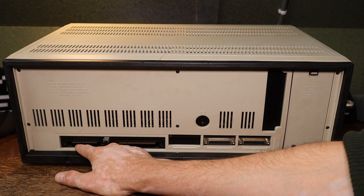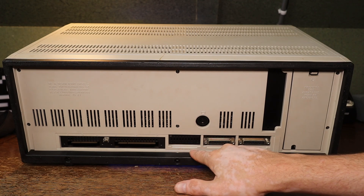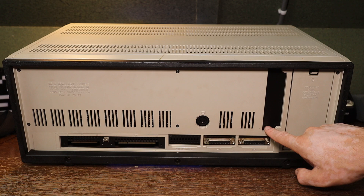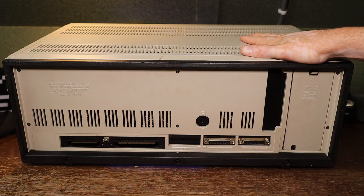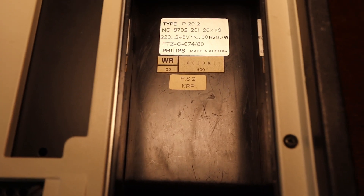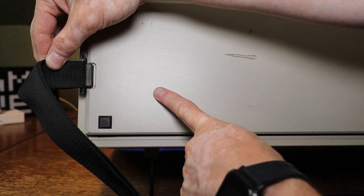Looking at the back of the computer: here's a connection for an external disk drive; this is the connection for an external hard drive using the SASI standard; this one says external terminal but it's not populated nor mentioned in the manual; this is an external monitor connector; this is a serial port and this is the parallel port. There is also an expansion port — the available extensions were either memory or an 8088 power board, which gave this computer MS-DOS capabilities. It would be pretty cool to find one of those cards. Behind a little latch is the cable for the keyboard, and this button releases the carrying strap — a pretty cool mechanism.